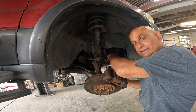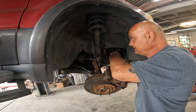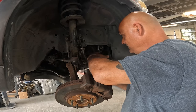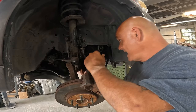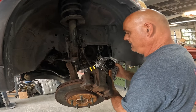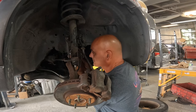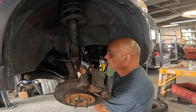Make sure when you're going back you put this little cooling tube in first — that keeps the alternator cool. Looking at this job I was hoping to come up with a shortcut to help you out if you're doing it at home, but I think the only shortcut is just having experience. Book time calls for a little over seven hours, but my total time is probably going to be around three and a half hours, and that's only because of experience. If you're at home doing it, just be patient and plan to make a day of it. I took the pulley off for installation — it just goes in so much easier that way.